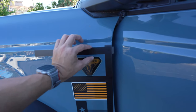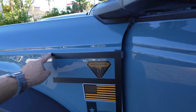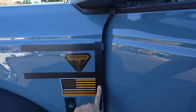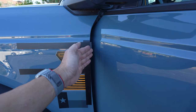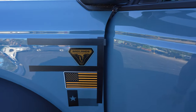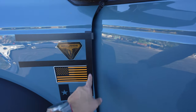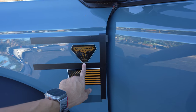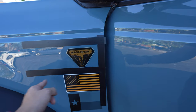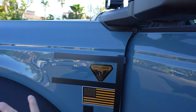These alignment strips run 1 inch tall and 12 inches long. I used the fender line right there for the top one and then dropped one going straight down. Your door actually curves a little right there, so it makes the front fender curve — 90 degree angle right there — and then a strip along the bottom of the Badlands going the opposite way. Again, another 90 degree angle. So this area is completely cleaned and prepped.